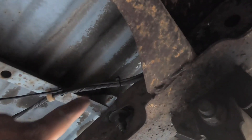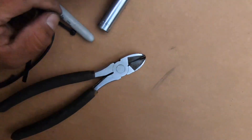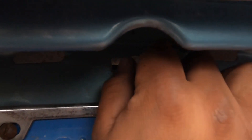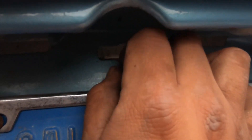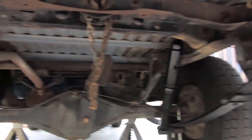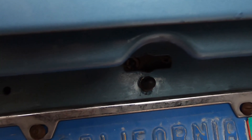On this side it goes straight over — similar to the passenger side, we still got it over the frame. It's not super tight so there's a little bit of play. Back here you only see this little piece — we're able to remove this and fill it up with air. These have to be a minimum of 20 PSI and a maximum of 150 PSI. We're gonna do that tomorrow because we don't have an air compressor right now. That's it — the shocks are installed. We have similar ones on the TrailBlazer with the sound system in the back and they do pretty good. Hopefully you guys enjoyed the video — like, comment, subscribe, follow us on Instagram at yonke_oxc_film. We'll catch you on the next one.